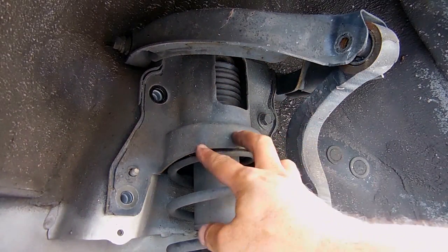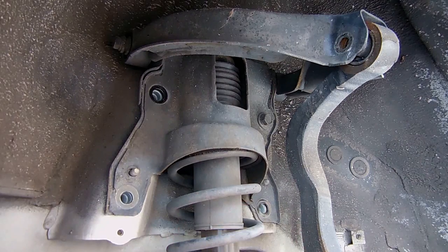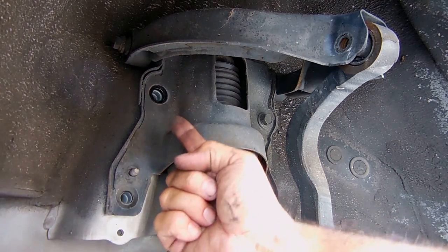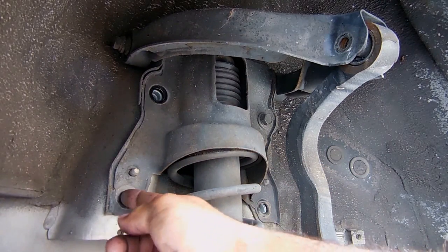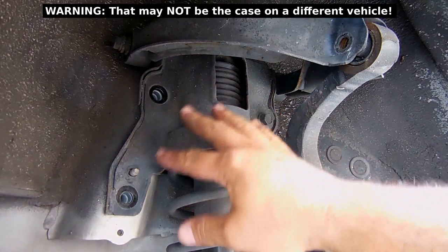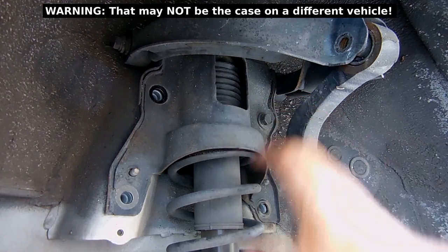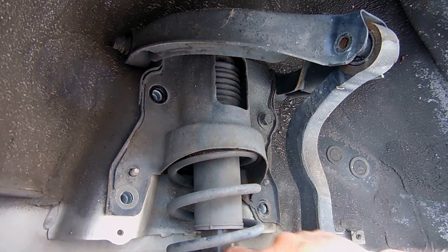This is like a clamshell — there's an outer piece of steel and an inner piece, and you can see they're welded together here at the corners. So when you take these bolts out, don't think this is going to separate and the spring is going to fly out — this is all going to be one piece that has to be removed from the vehicle. The spring will have to be compressed in order to remove the gas shock.